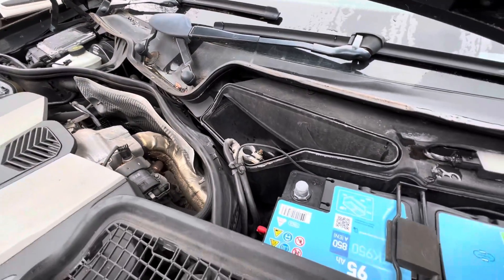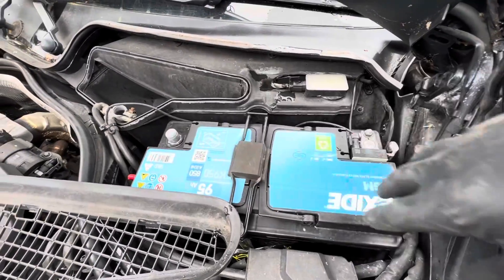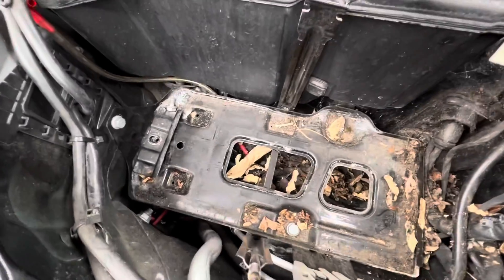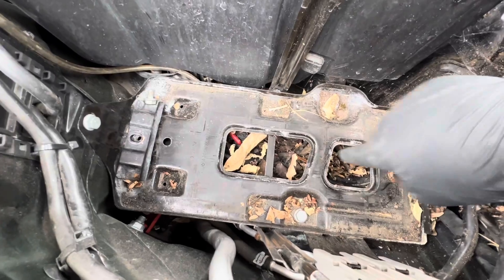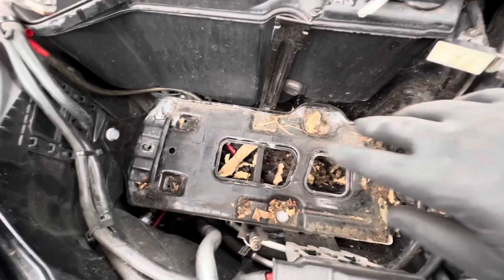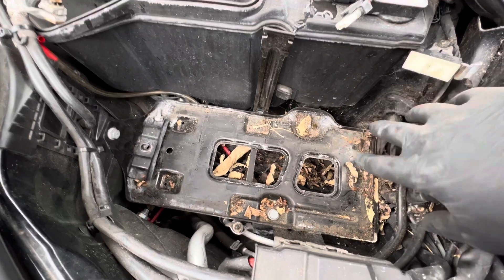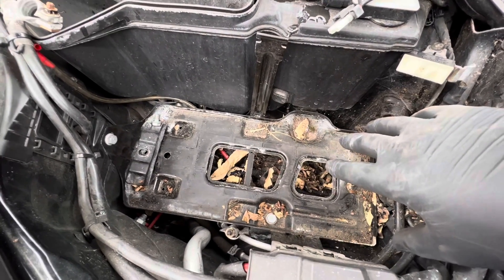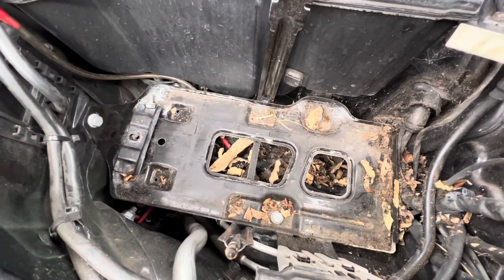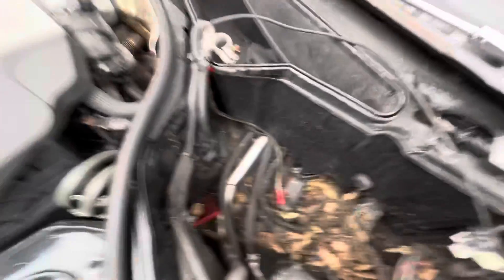All the central drains and everything — make sure these are all working. I'm also going to take the battery out and give a good clean round in case there are any leaves and debris at the bottom. Here's a good reason to take the battery out: if you look in here just underneath the battery tray, you've got loads of leaves. You don't know whether you've got any critters — mice, rats, anything like that — that get in and make a nest and eat all your wiring. So we don't want to make this comfortable for them, and also they could get burnt on the exhaust. Let's get this battery tray out and hoover all this up.